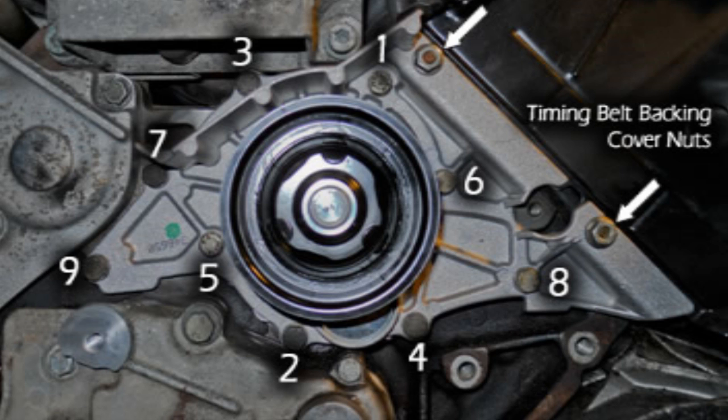Make sure the gasket does not fold over, causing improper sealing. Begin by evenly hand tightening the water pump bolts in the order pictured, then torque 10mm bolts to 7 foot-pounds in the order pictured. This ensures that the composite gasket is compressed evenly for a proper seal. Wait 10 to 15 minutes after torquing the water pump bolts to 7 foot-pounds, then retorque the water pump bolts again to 7 foot-pounds. This ensures that the composite gasket is compressed and properly set.